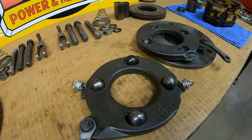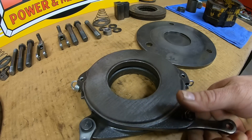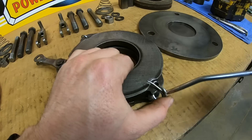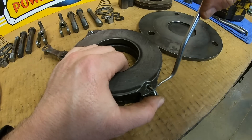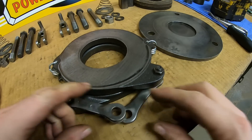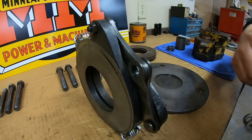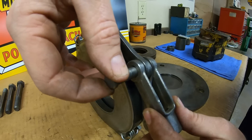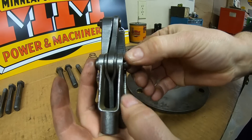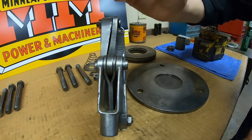Whenever possible, load some new springs on there, especially if the old ones are 40 or 50 years old or of unknown age. Liking how that's working right there. Just like during disassembly, the first spring goes a lot easier than the second one, but we've got them hooked on both sides. We can bring both pull links together and pin the clevis on as well. I put some regular grease on this pin — I like having these pivots lubricated. It really makes a difference in how well these brakes work if everything moves freely. We can put these cotter pins in with a permanent bend since we won't need to take these pieces back apart.